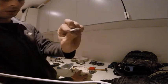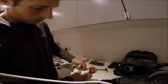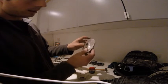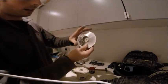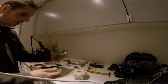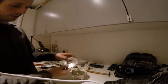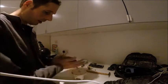Next piece is this washer — note the way it goes, the ridge goes on the bottom. Then we have the impeller. Mine is actually a bit of a mess so I'm going to spend a couple of minutes cleaning that up, just knocking all the dust out of it. I've cleaned out my impeller — there was a load of plaster dust and some hair in it, which is probably what caused my hoover to stop working in the first place. So it's nice and clean, completely empty, no dirt in there.